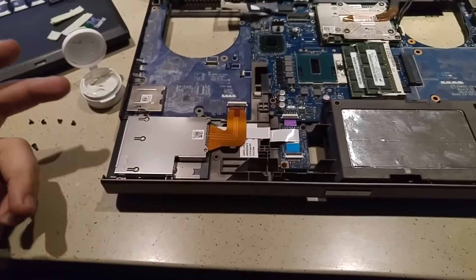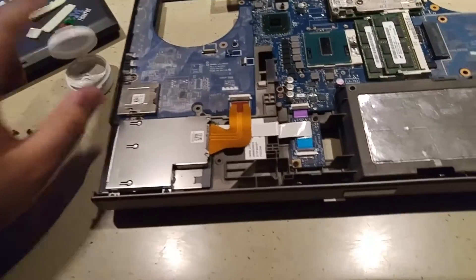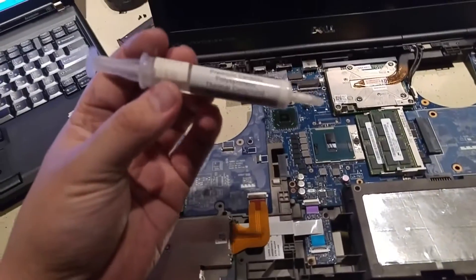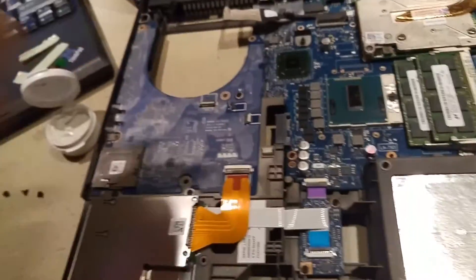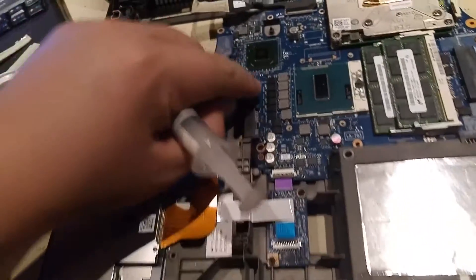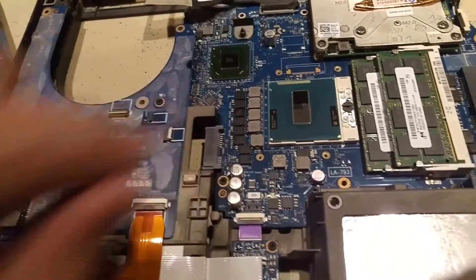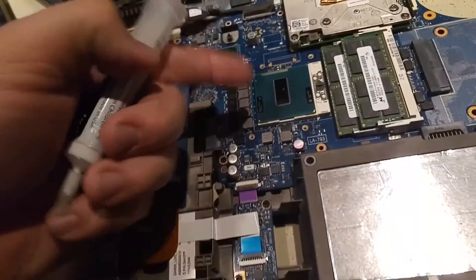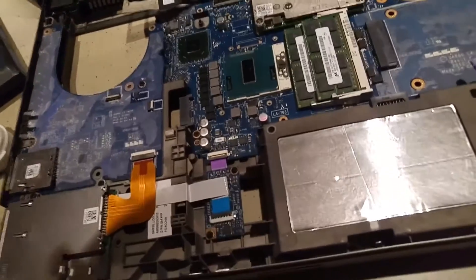After a little bit more searching around, I've discovered that the K5 Pro — the Computer Systems guys — recommend you use K5 Pro in conjunction with standard thermal compound for CPU installs. So on the CPU, use this stuff or their version, the K4 Pro. Then on BGA devices like the chipset and surface-mounted devices, go ahead and use the K5 Pro. So anything that originally used thermal pads — this is what the K5 is for.